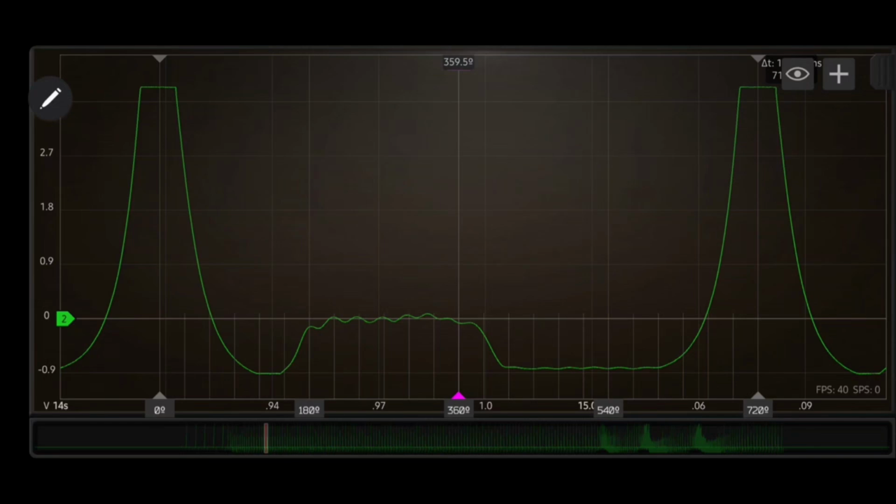This car right here, however, the ignition timing was off, and they had me come verify it quickly by checking the crank sensors and cam sensors, and it was off. You could tell when it started. It had a tight spot, and then a real loose spot, and tight, like the timing was off. So they redid the timing. It runs better, but it still wasn't running right, so they called me back to look at it again, which you guys will see.